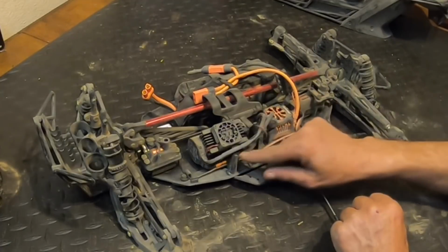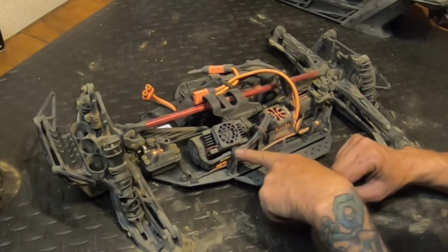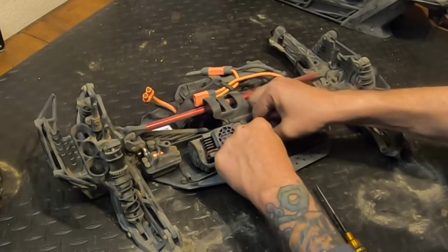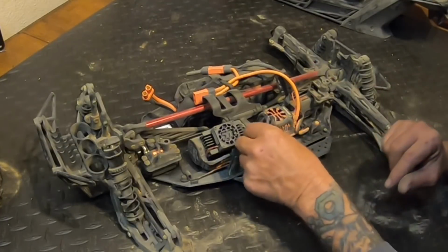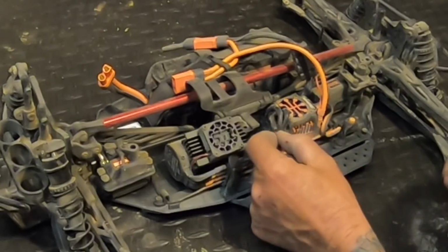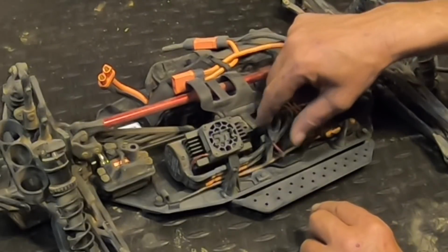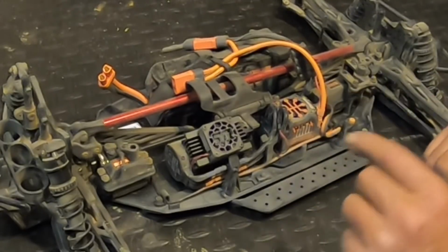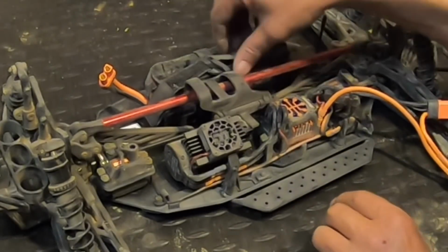This wire has now popped out of the bracket here. That's supposed to be in there. Not really a big thing. I do like how they put a wire support here for the motor wires now, and I know these are supposed to be set into that thing as well, so those popped up. The fan wiring is really close to that gear. That thing can actually hit the pinion, so I don't like that. So I'll probably zip tie this over here somewhere, because you don't want anything around your pinion gear that could cut it. I'll probably throw a zip tie around that. And that's the little quality things I'm talking about.